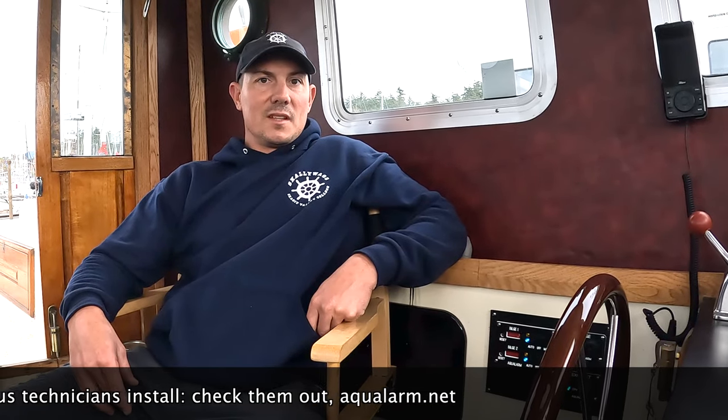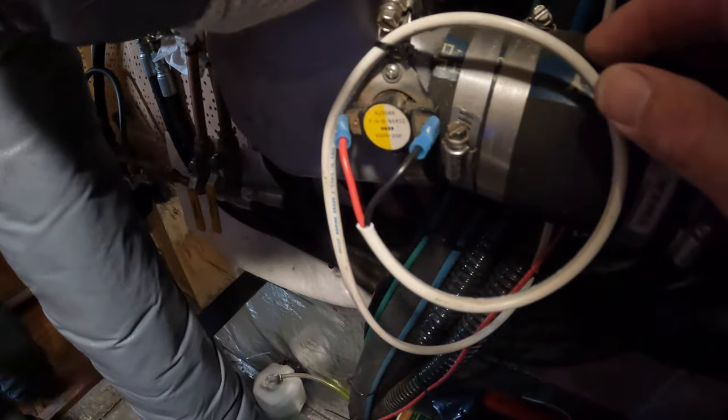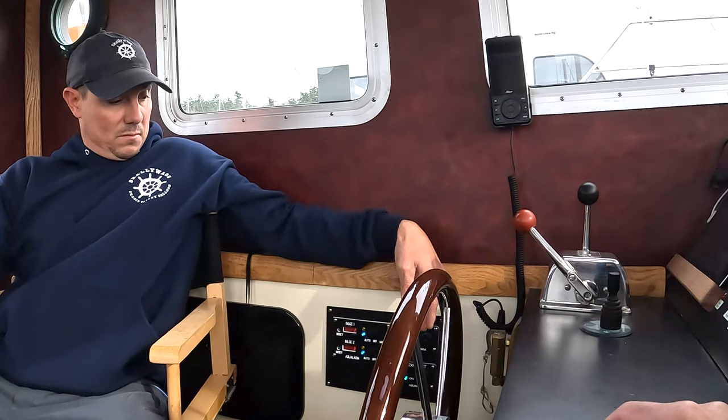So Giovanni, how hard is it to install one of these? Could a DIY person do it? This is such a good beginner DIY project. It'll give you some practice cutting a hole for your display. And honestly, it's a couple of wires. You make sure that you have your OCP as close to the battery or your power source as possible. You run your positive and negative wires to this band clamp and back to your exhaust alarm, and it's done. The kit comes with a wiring diagram, but it's really just OCP, two wires back to the battery, from the battery to your exhaust alarm and back, and you're in business. Simple as could be.